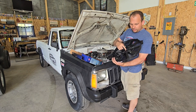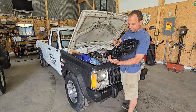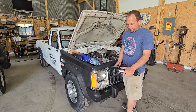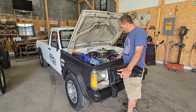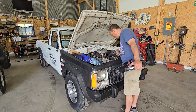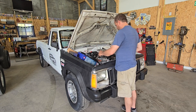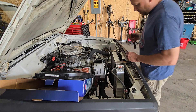I've got to flip the fan. When it's set up as a puller and you make it a pusher, you've got to flip the fan over and reverse the polarity. I think that's probably why the old setup isn't working — those fans are set up as pullers and I've got one running as a pusher. I reversed the polarity but maybe the blade isn't right, so we'll take all that off and put this new one on.